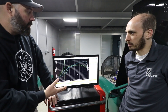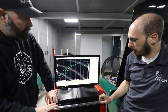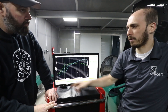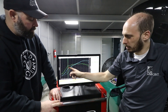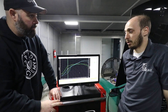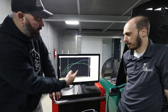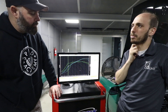With the GTX 3071, the nitrous is just helping spool the turbo and fill in early — it's in at around 4,500 RPM. But for drifting with this gearbox, they need response even at 3,500 RPM, trying to bump that back 1,000 RPM. With nitrous they're at 4,000. With the smaller G25 550, they're hoping to get down to around 3,250. The G25 alone should account for about 800 RPM of spool improvement, then add the nitrous on top. Currently making 400 horsepower at only 17 pounds of boost.